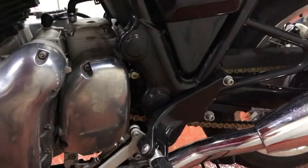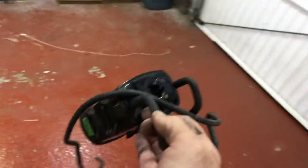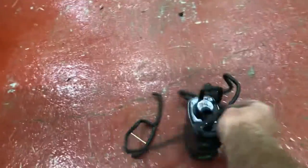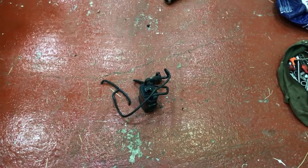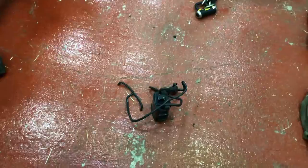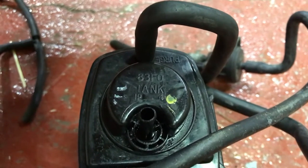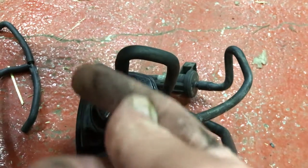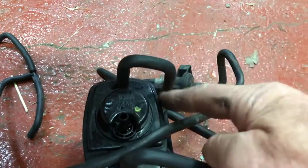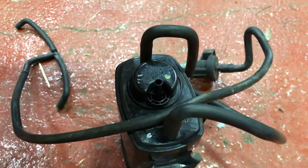When it sits on the bike it sits like that. When you get in there and take your sprocket cover off you'll see it — look for this clip, that's where I saw it, and it fits on the lug under the battery tray. Once you pull that plug out, you've got sufficient wire on the harness to move it up here. After that it's a piece of cake — you remove all your pipes off the cartridge. I've put them all back on just for demonstration. You remove the canister, then get an 8mm stainless allen bolt that's included in the kit. Take the pipe from the fuel tank breather — that's the one that connects where it says 'tank' — and just put the allen bolt in it and screw it in. The other pipe labelled 'purge' goes to the purge valve, and the remaining one is just a breather that goes behind the battery.